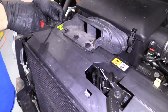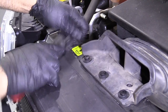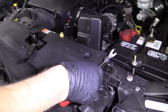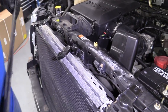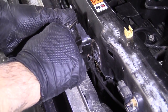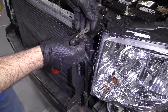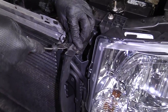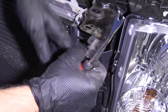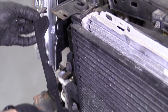I'm just going to use a trim tool, get underneath these push retainers, and pull these up. Slide this panel out of the way. To get this handle out of my way, I'm going to take this bolt out using a 10-millimeter socket and ratchet and pull it off. Now we want to pull these little plastic shields out of the way — take a trim tool, just get underneath here, lift up; there's a little nub that goes into that slot. Slide this out of the way, same on this side.